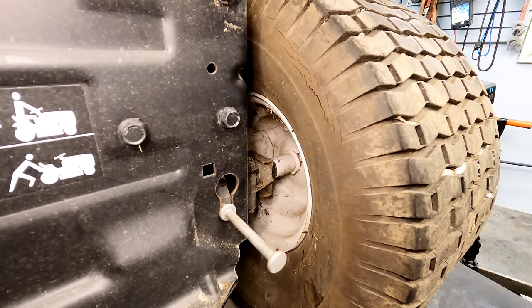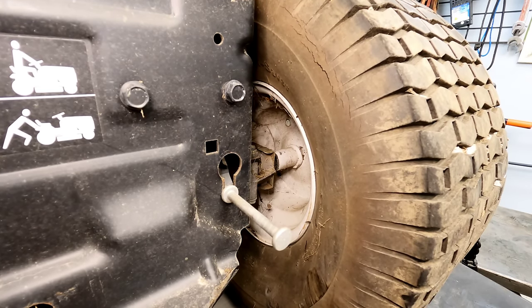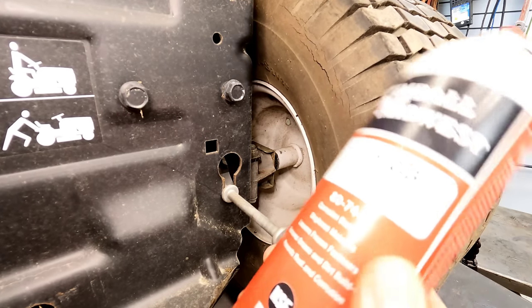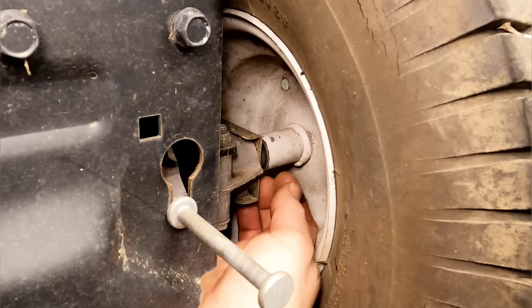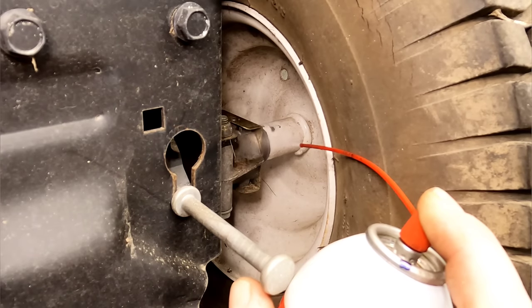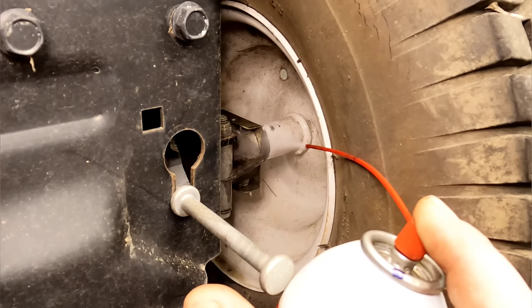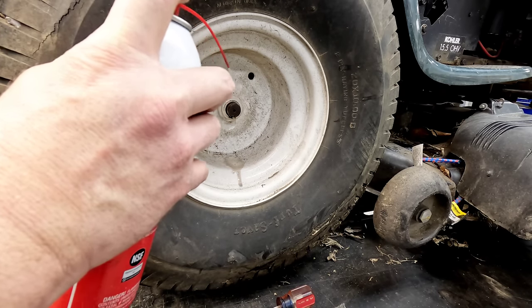Once we jack it up, I like to clean out from the inside of the rim — just blow everything out. I like to use Kimball Midwest penetrating oil. We're going to spray it all along the inside of this rim, right in this area. If you put the slit a little bit to the upside and spray right on top, that fluid is going to get all down in there real well. You have to spray quite a bit to get it on that shaft. That's where we start lubricating it up. You can leave it sitting like that for a day or two — it is going to make it easier. Keep spraying it down, spray the other side too, tip it to one side and let it flow down in.